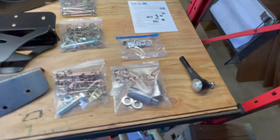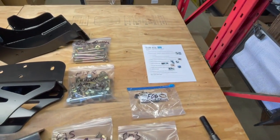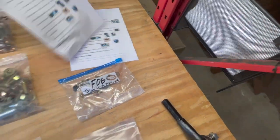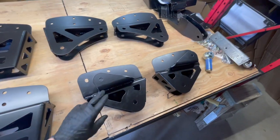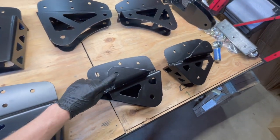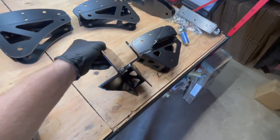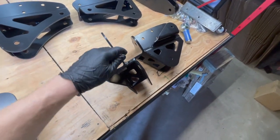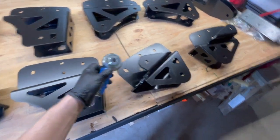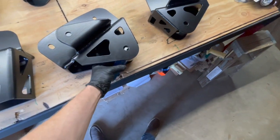There's hardware for the whole installation, including parts for the steering — drag link hardware — and a packing list showing all the parts and hardware included. This one is the low-lift four-link. What makes it the low lift is that the pivot point for the upper tube is mounted beside the frame, so the upper tube is in a slight S-shape. It mounts here, the lower tube mounts down below, and it uses rock crawler brand rod ends — one up top, one at the bottom.